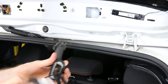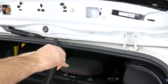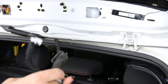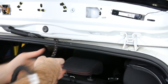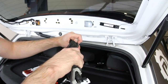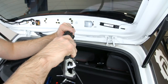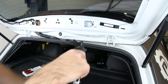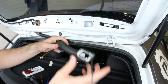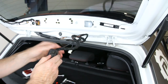Depending on your preferences, you can cut the boot and break off the ends if you don't want to slide it through, but sliding it through like this is going to be your easiest bet. Slow, steady pressure works best. Click that clip back in place so you don't lose it on the way out, and now we're pretty free and all of our stuff is out.